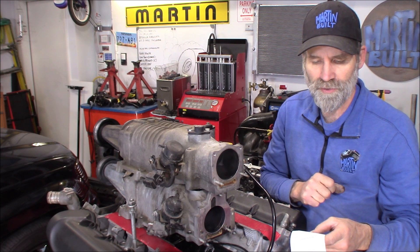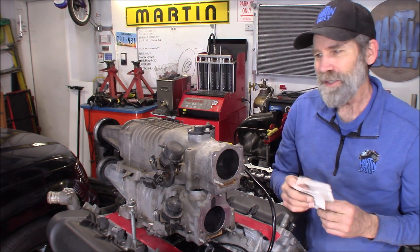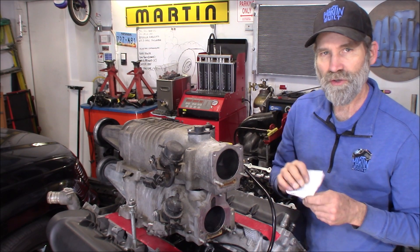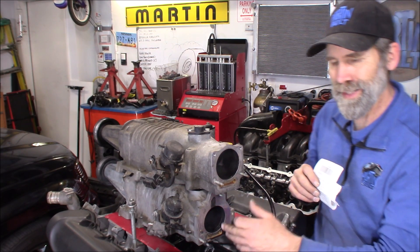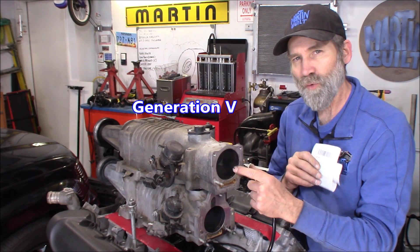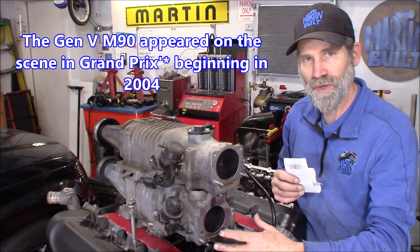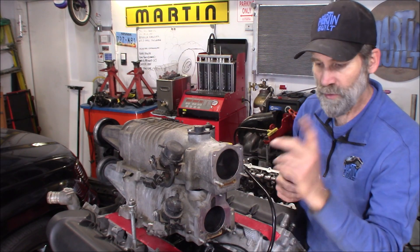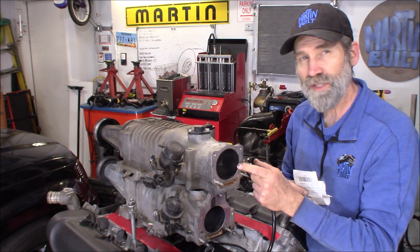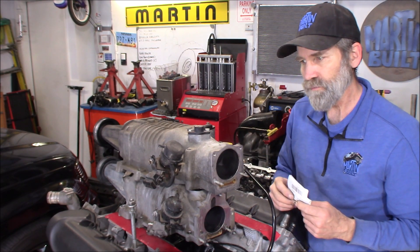There's also some other charge for 28 cents. I just decided to go ahead and get both of them — there's one left out there. Now, these are different generations. I'm pretty sure the one off the 98 is a generation 3, and the one off the 04 is a generation 4. They went up to generation 5s as far as I know. They changed throttle bodies — this one having a 3-bolt, this one a 4-bolt. This one being 72 millimeter, and this one at 76 millimeter. So, a little bit larger on the later model supercharger.